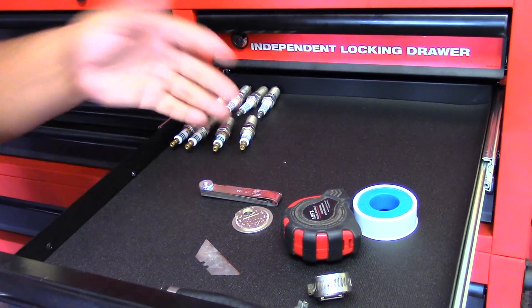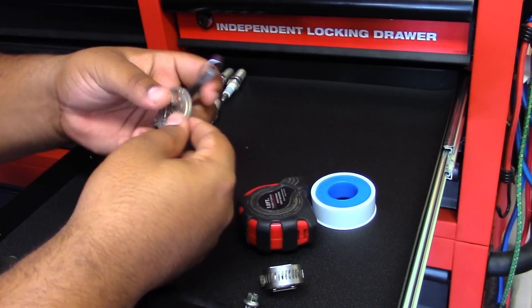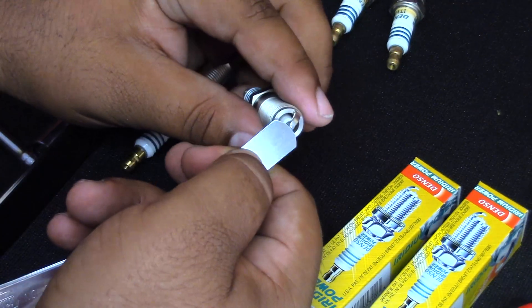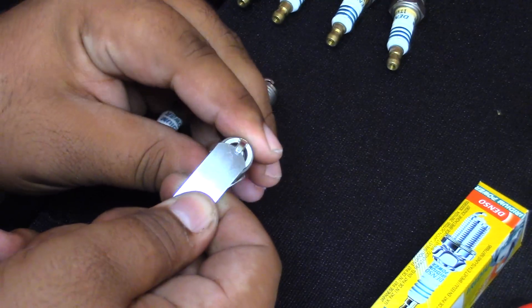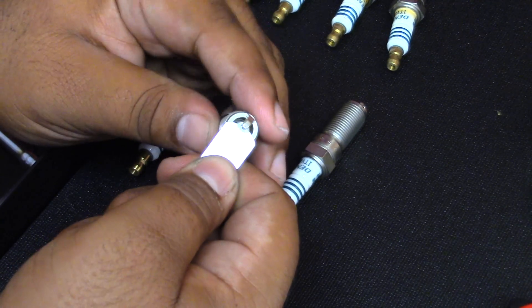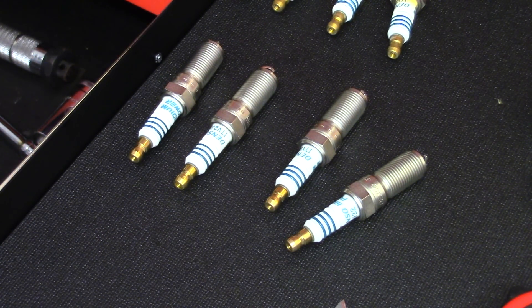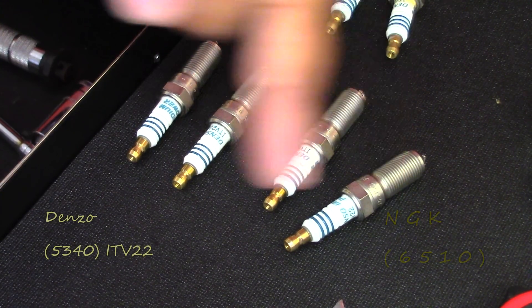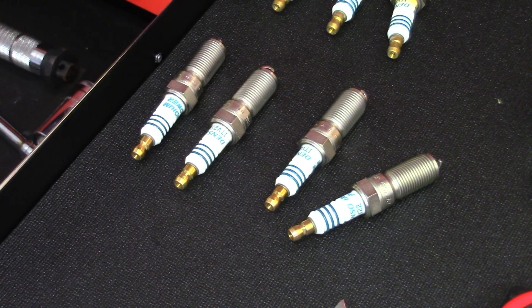I got lucky enough where mine were still intact — I guess I wasn't being a brute like I usually am. It even says 'gap opener' on here, so that's what you use it for. It's easier to open it too much and bring it back down than having to replace the whole plug, because these guys are like seven to ten dollars a piece. So if you figure if you screw up one, that's ten bucks, and if you screw up all four, you'd be out forty bucks. Keep that in mind — best thing to do is use both of these as a combination: this to open it, this to check. Okay, with that being done, let me show you the part number for these.